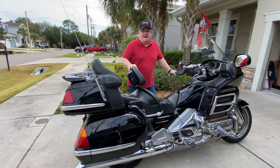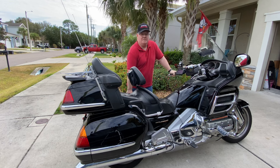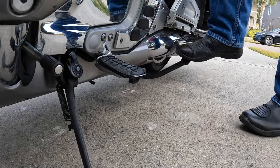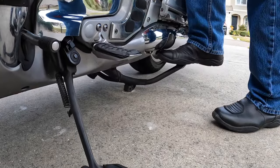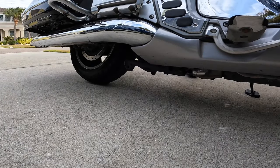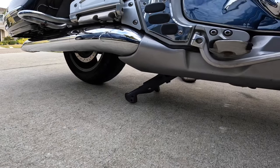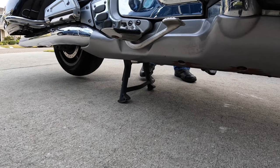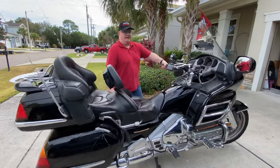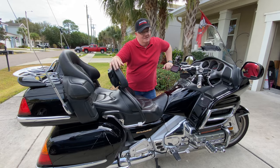Just so you can see this from the other angle, I'm going to put it back up on the center stand. Simply take this hand on the rear handle, this hand right here on the handlegrip, your right foot on the center stand — level it up and you'll feel the other one just touch, then simply lock it up and back. There you go — Goldwing on the center stand. 900 pound motorcycle, but it's not that tough.